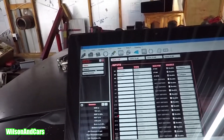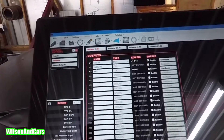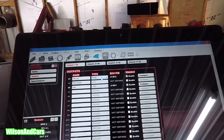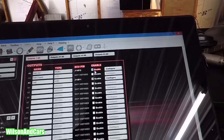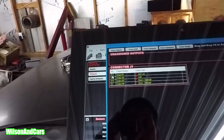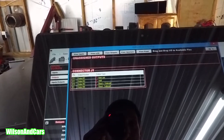Now check your outputs. We got our input going in — the trans brake to ground on A4, enabled. Now go to outputs. As you can see it says 'Trans Out' right there, and I've got it selected at pulse width modulated positive on my J1 B12 pin output. Enable it, go to your pin map — it shows B12, output number one, pulse width modulated positive, P-plus, trans out. Take it and drag it down — that's how you get that set up.